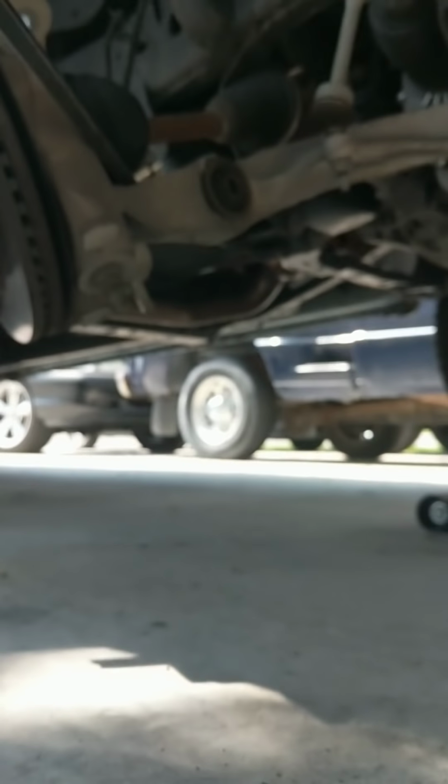Take a look. There are two narrower bolts here. I'm pretty sure these were the back two, to the inside of the frame rail, and this one is to the outer edge by the tire. It only lines up one way. So we'll get a nut in your hand. And then here's the fun part, trying to line all this up properly. I press down on the pry bar with my leg so I can get the strut into position here.